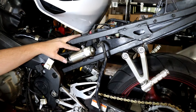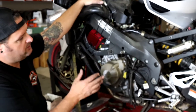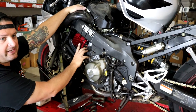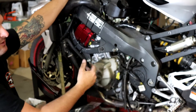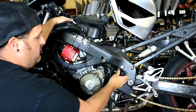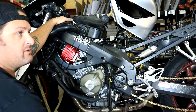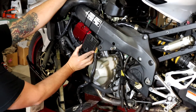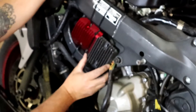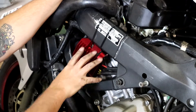With the old regulator out, we're installing our new CNC regulator with direct battery connections, which is really made for the VFR but works fine with the same connector on the CBR 600. The wire length is very different, and if we mounted it at the stock location in the back, we actually can't anyway — this regulator has a much larger housing. You can see here's our original versus the new one; there's not even enough room to mount the large CNC aluminum regulator underneath the fairing.